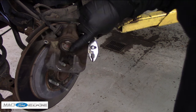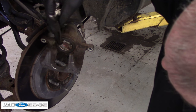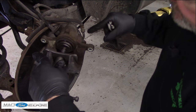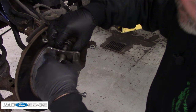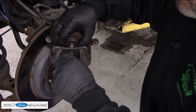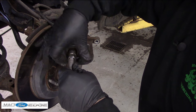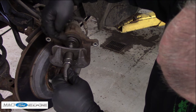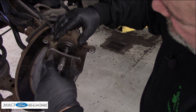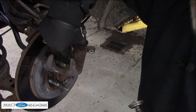The problem is the tabs — I need to get the tabs mounted straight up and down. Right now they're at an angle, so I have to put this back in and line it up to get it set at exactly the right position. There we go — now I can tighten it back up. I'll loosen it to check where I'm at. I have it lined up perfectly with the nub right here on top, so now the brake pads will fit in here.